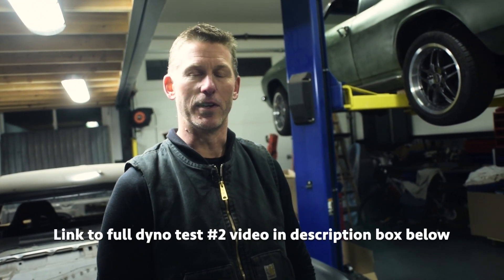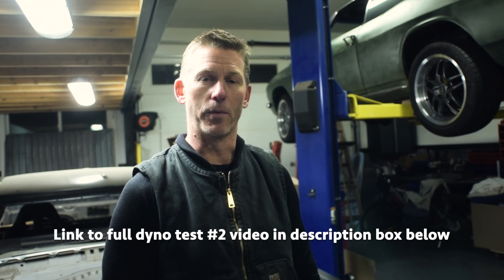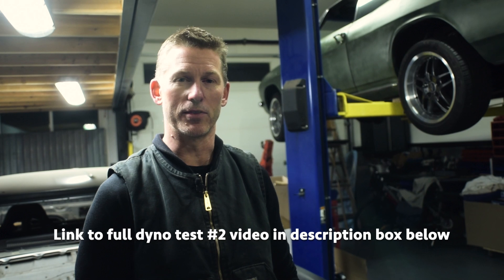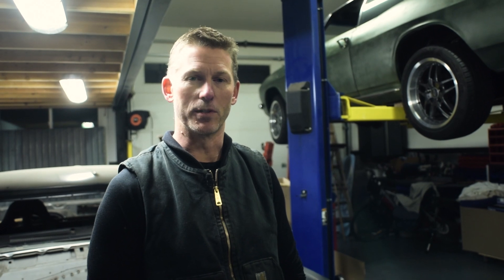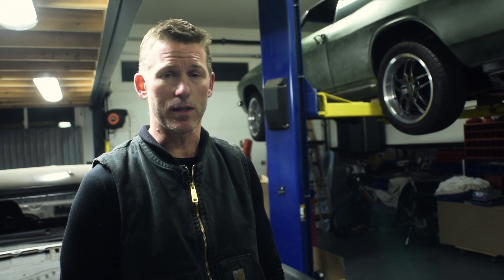The purpose of this video is to re-upload dyno number two — it just for some reason hasn't gotten a lot of traction on the site. We wanted to show what the fix was and give a bit more background as to what the engine was and the purpose of building it. We did not design this thing to be an 8,000 RPM revver. A lot of people say, 'Hey, it's got a three-inch stroke — it must hit 8,000 RPM.' Well, with more camshaft and a bigger intake manifold, yeah, it probably would. But our purpose was to build something that was going to be really reliable, fun to drive, run on cheap gas, and not be radical in town. We wanted something with good vacuum for power brakes and that kind of thing.